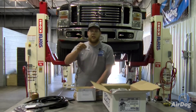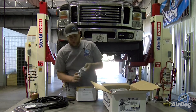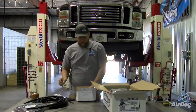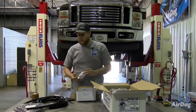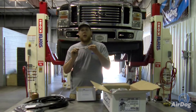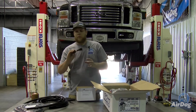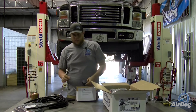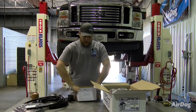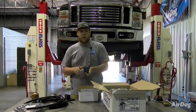It's going to come with a customer service O-ring kit — this is just a replacement of every O-ring that would be in the kit, so throw this in your glove box just in case you ever need anything to service. It comes with your hardware kit needed to install and mount the pump on your frame rail, all the individual fittings needed for the install. This is going to be your return Y — this is what we're going to use to tie the two factory returns together and add your AirDog return for a nice seamless install, no need to cut your filler necks or anything like that. A couple zip ties to clean up your wiring and hose. This is a spacer block that will be used with the sandwich plates and cradle bracket, just to space it off the frame rail.